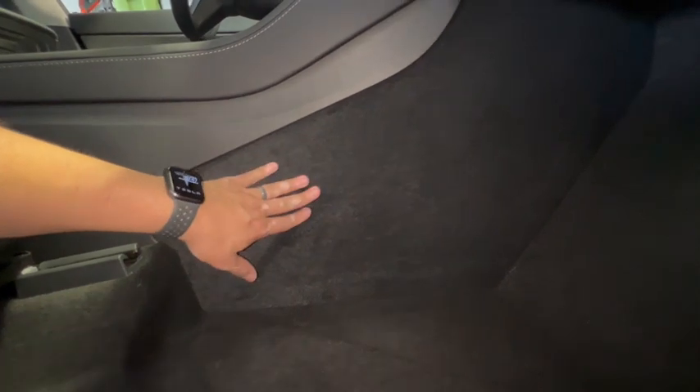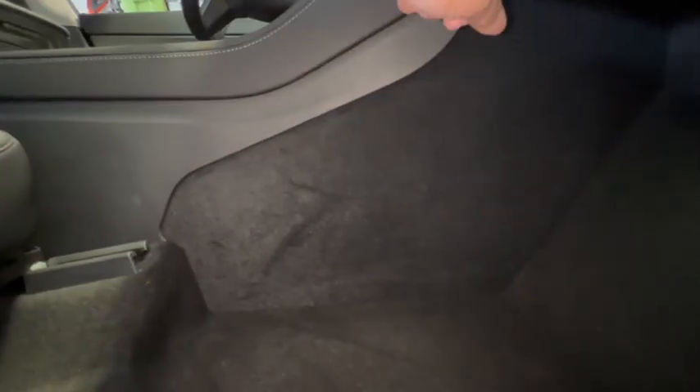Inside the vehicle, we've taken the mat out of the floor and moved it all the way back. We're going to be taking this entire side panel out — it's just clipped on. If you pull it from the back corner right back there, it should peel right out. It has clips, of course, so just be careful when pulling it not to break them, since you want to be able to put them back in.